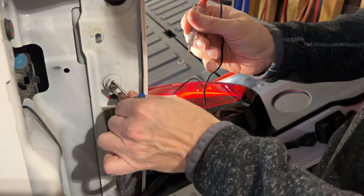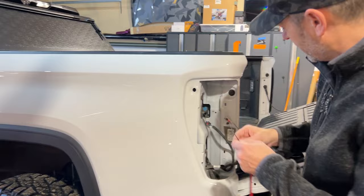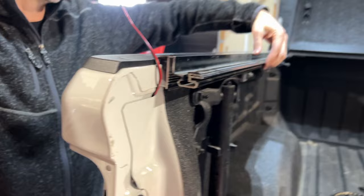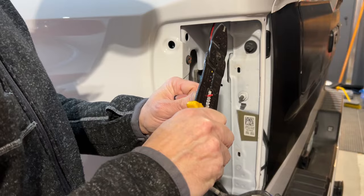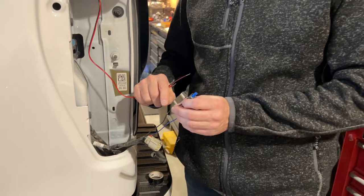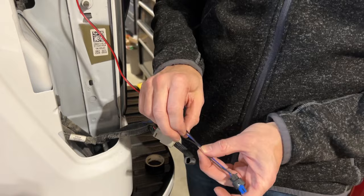Just got to find your good ground — there we go. Now that we know this is a viable power source, we're going to fish this through the side of the box and hopefully pull it out of that hole up at the front. We actually lucked out — there's a little spot right here that I'll be able to fish this through and channel it underneath the bed rail for the box cover. I'm going to take the wire loom off so I have a little more to work with, and we're going to splice and solder these wires in. I've taken the sheathing off the power and ground wires and changed the length of the ground wires so once I solder them and wrap it back up in the wire loom, there's no way they can short out on each other.